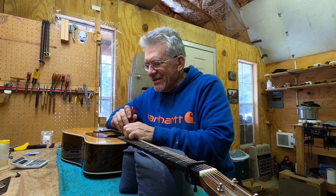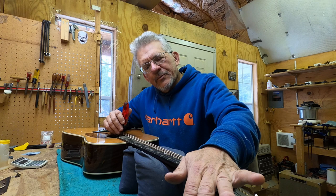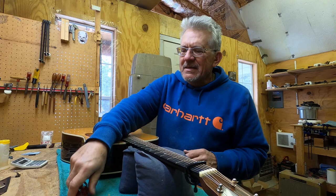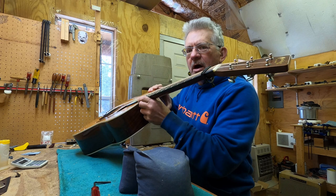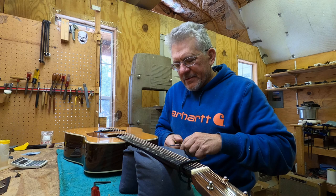Turn — and that's really loose. I can tell it's going to go more than that. Go ahead and tighten it a little more, make sure the wrench is seated in there, pre-stress the neck. It's so much easier when you pre-stress it. Take a look at it — I'm just going to look at it without measuring yet. It's still got quite a bit; I bet it's probably at about eight thousandths of an inch now.